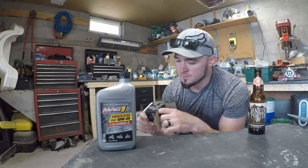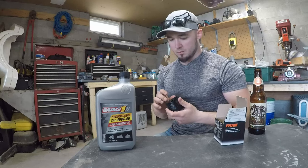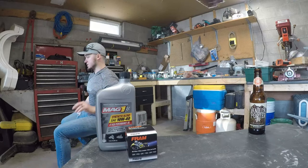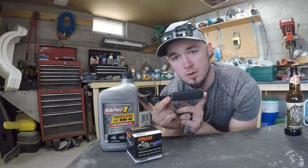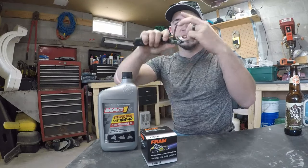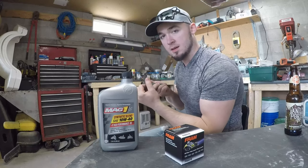The difference between this one and the K&N filter is that the K&N has a little bolt cap on top, so you can put a ratchet directly on it and not have to use a cup wrench. I don't have the lower cowling, so I'll be able to get to this fairly easily with my grip wrench — the oil filter wrench. Having the joint to get around those pipes is a definite must. Sometimes if you take a welder and put a couple tacks on the inside and scuff it up with a screwdriver, it'll grip the oil filter a lot better.